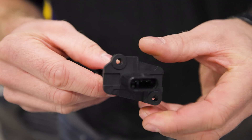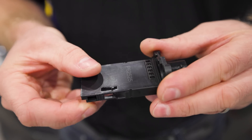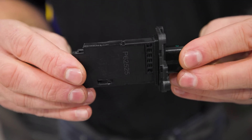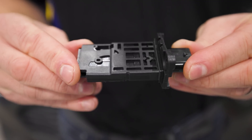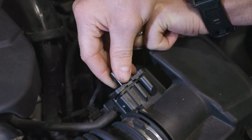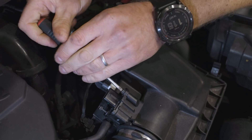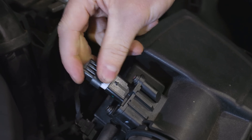The second common type of mass airflow sensor is this little cartridge-style one. These are really simple to install — they normally bolt in just after the air box with two screws. Once again, check the connectors and all the pins going into it. It's just a case of undoing the two bolts, it slides in and can only go one way, so you cannot get it wrong. Bolt it up, connect it back up — it's as simple as that.